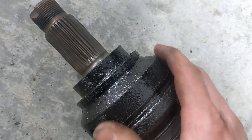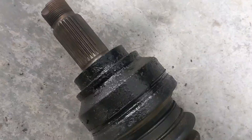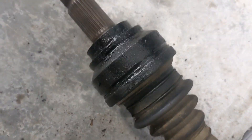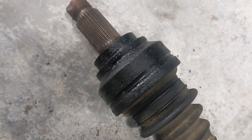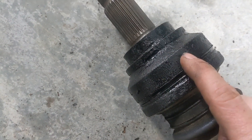I've been having the triple warning lights on the dash — 4x4, all the errors that come along with a bad ABS sensor, or wheel speed sensor. I was trying to find info online and it's a bit confusing whether or not these 2011s have a reluctor ring. I found info confirming that they don't.